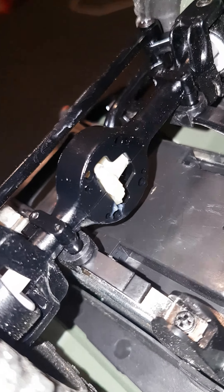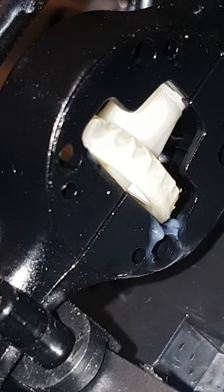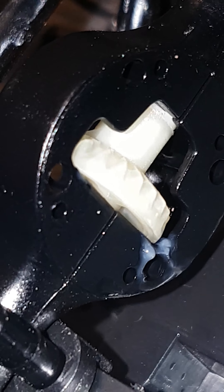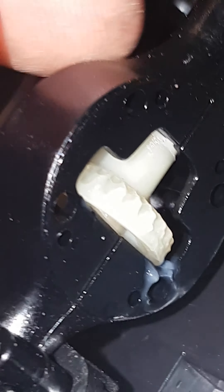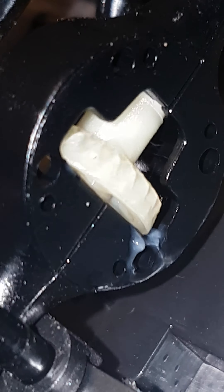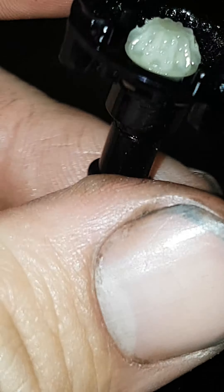As I thought — a diff. If I can zoom in — it's a solid axle with just the crown wheel in the middle there. No spider gears, nothing. So there's a solid crown wheel driven by this gear that comes off the tower shaft. This tower shaft turns that gear.